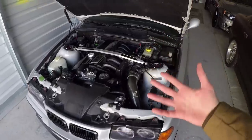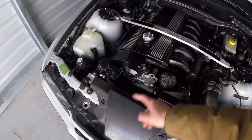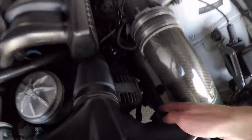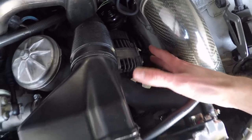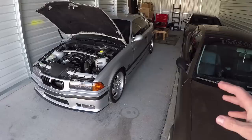So what are those few common problems? As far as the big ones go, they are: the need to rebuild the vanos, the need to replace things in your cooling system, and problematic leaky power steering lines — you can see that line down there, but it's not leaking right now, luckily. In the case of the E36, none of those things are very expensive.